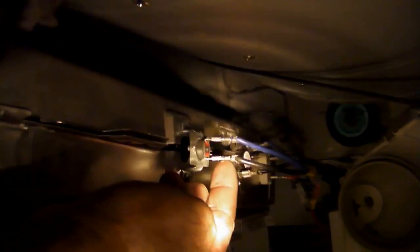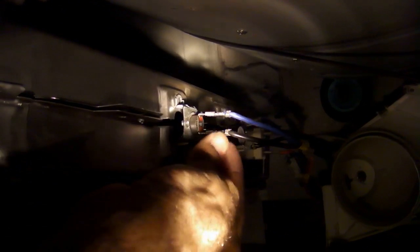I'll stick my hand in here and try to keep the light showing. I'll show you how to disconnect the wires. When you're crimping the wires, mind you, don't crimp the part that's connected to the lead or to the contact. You crimp the silver edge. Hold it up, son. Good. Thank you. Silver edge, and you crimp right here with your pliers. When you crimp your wires with your little needle nose pliers, you crimp here to pull them.